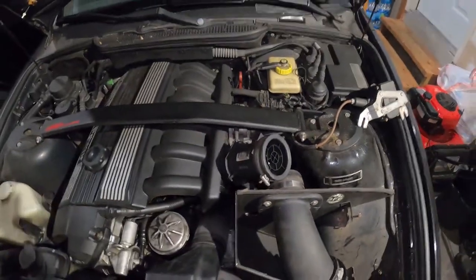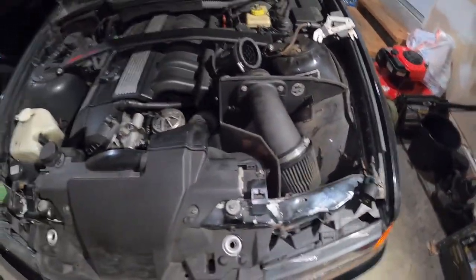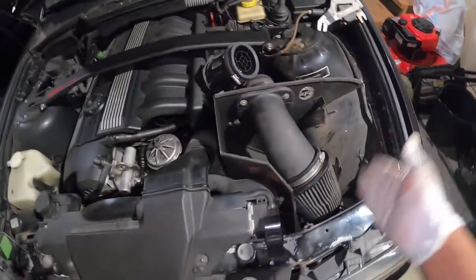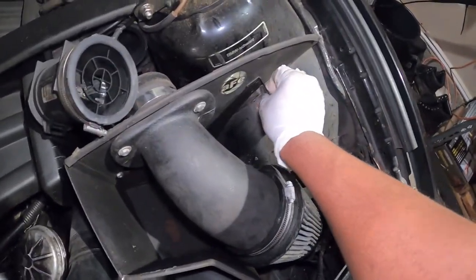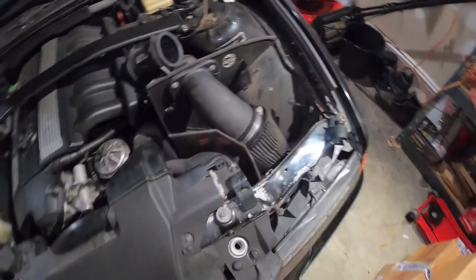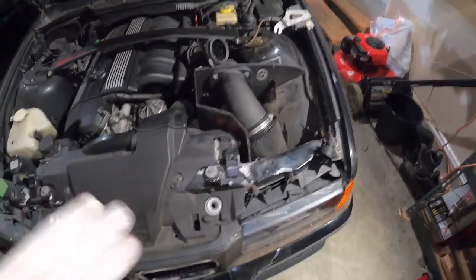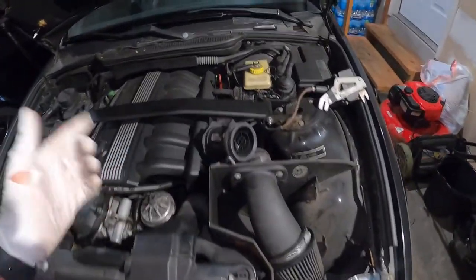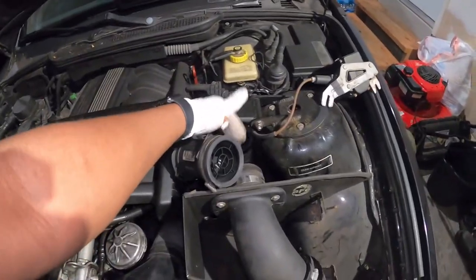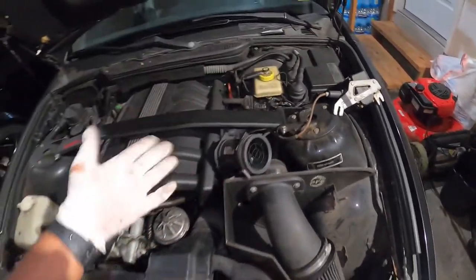This is how the setup is going to be for the moment — I won't be able to drive the car until I get that sorted out. But this is the final product. I'm going to put this piece back with a 10-millimeter bolt, and that should do the job. This is it minus that one portion, but this is how you install the AFE intake. I'm going to try to order that boot tonight so if I have it this week I'll add that at the end.